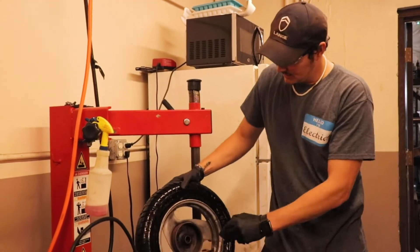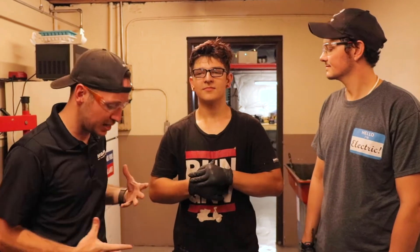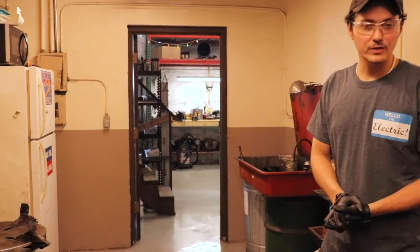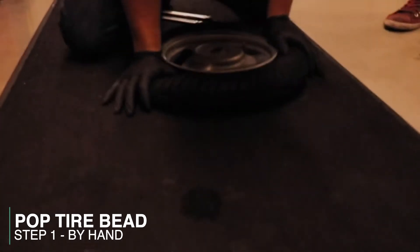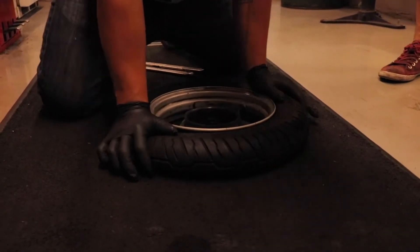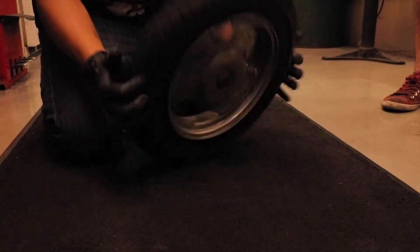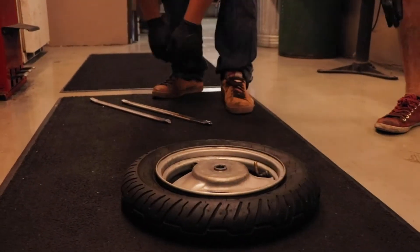Now we're going to show you how to change this tire by hand. Brad and I have done a couple of these before, but we've decided it's a good opportunity to introduce Kevin to our Scoot Fam - he's worked at a couple of scooter shops before, so he's a good person to show you how this is done. He's going to do all the work and Brad's going to walk you through the steps. Obviously the first thing we want to do again is pop the bead - put some pressure on the tire. With skills like Kevin's you can put all your weight into it and hopefully pop that, especially for a scooter tire.